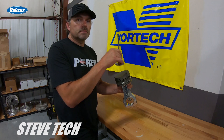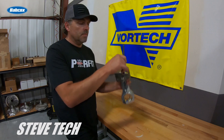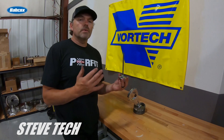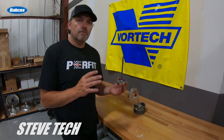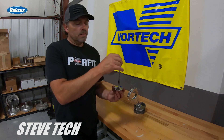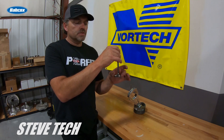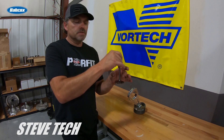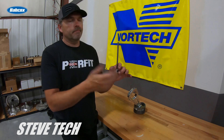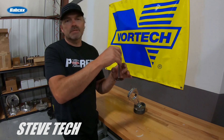So we need that little bit of radial wall clearance right through there. We don't make it exactly perfect — we need to open that up a little bit. But for this piston-to-valve clearance, since the valve is actually chasing the piston down and not coming up aggressively, we don't need a lot of clearance. On the intake valve, dynamically when the valve shuts it always bounces — it comes up, shuts, and bounces — but the piston can't be hit that hard in that scenario.